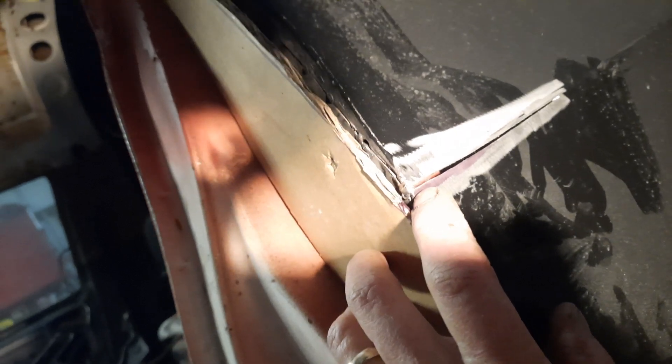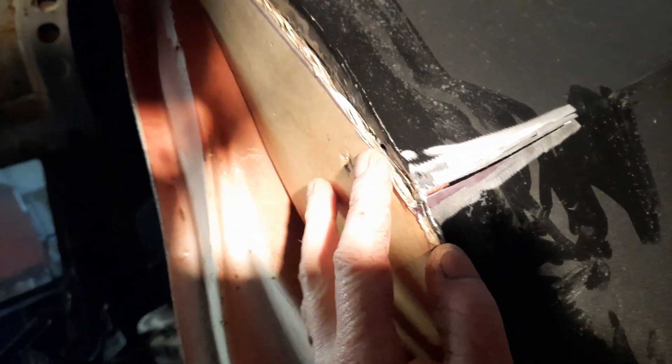You can see this is where the crease is on the other side. I've brought it down, but we're still not exactly right — we're still a couple of mils too high. This crease is still a couple of mils too high, but this is as good as I can get it without cutting off the entire panel. So I'm going to leave it at that and modify the door to match the quarter panel. This is really crucial — it's an issue when you've got a straight crease running the full length of the car; if it's not straight you're going to notice it.